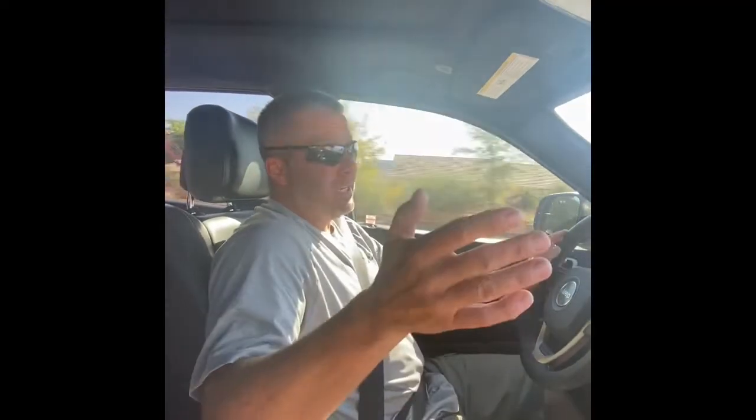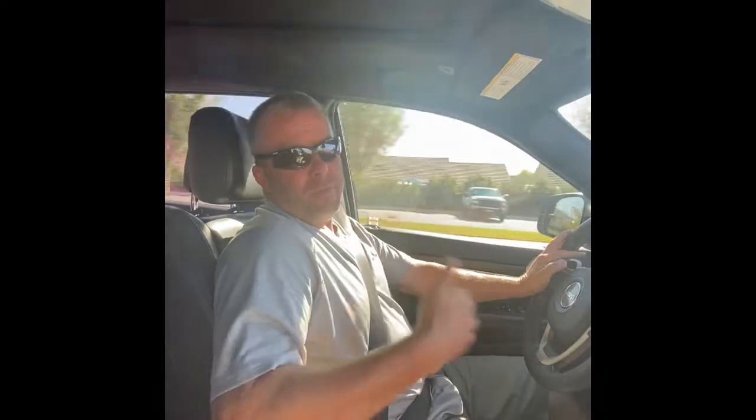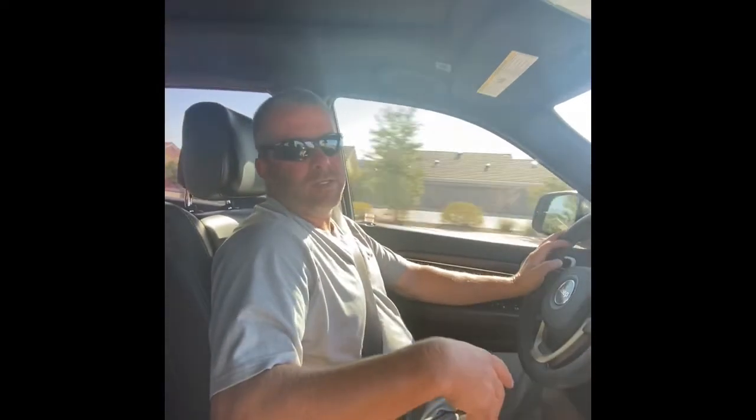We're testing it out — went for a little drive and everything seems to be working great. It's blowing really cold air now. It was just a little low on refrigerant pressure. You can see it's a really easy fix. If your Jeep Grand Cherokee is 2014 and up and using the same refrigerant, and it's making weird Darth Vader noises from the dash and not cooling well when it's hot, that's all it took. It was about 80 to 90 bucks, which is a whole lot cheaper than taking it to the dealer. Just get out and do it — don't be afraid, super easy fix.